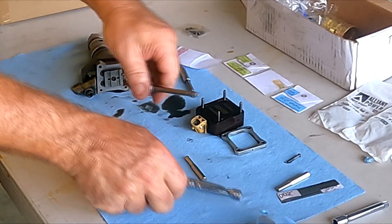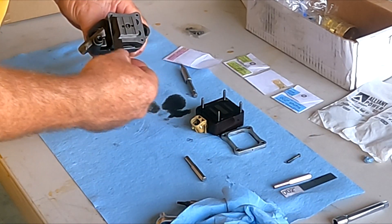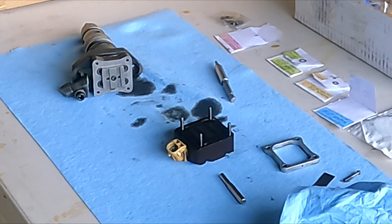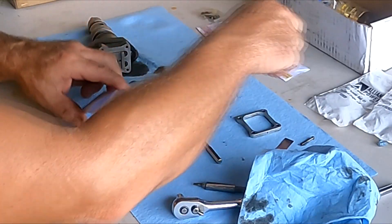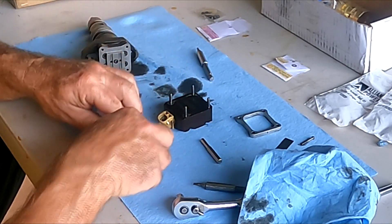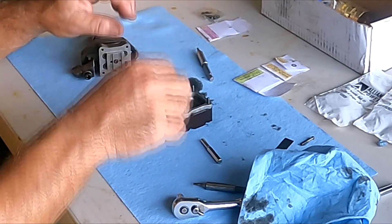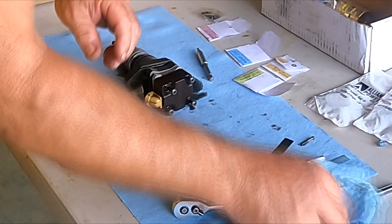Tightening the armature bolt with a little help from another socket. The orientation of that plate is important — the top side of the injector has the oil vent, the lines go horizontal to that, and the plug for the solenoid is at the top as well, so make sure you orientate it properly. Put the right spacers on, make sure the armature is nice and flat, then put the shims on the solenoid. They're all labeled armature and solenoid — pretty easy to install. I used a tiny bit of oil or sweat on my finger to pick them up. Then rotate the head over, put it to the injector, and use the supplied star sockets to put everything together.